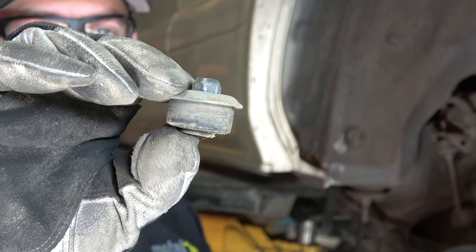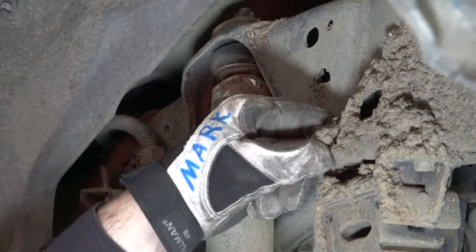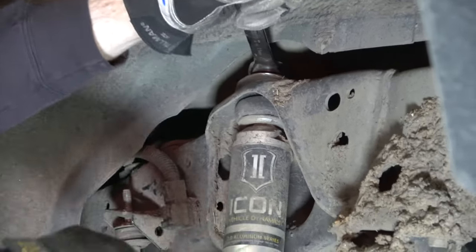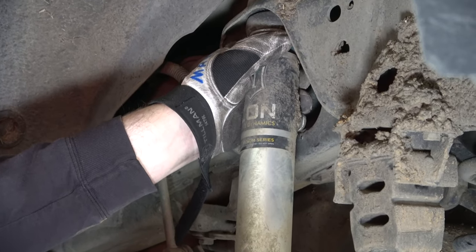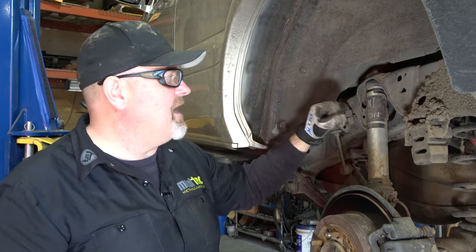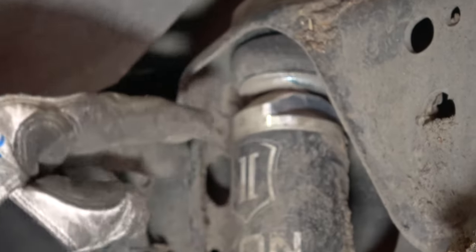That's the sequence when you put them back on again. Now we're going to take the top nut off — and it's great to see this truck is being used, actually getting out on the trail. We've got nice chunks of dirt to work with, but I'm happy to see the truck being actually used. So it's rotating on us — this top body is going to move back and forth, so we need to keep it from moving. We're going to take advantage of the wrench flats that Icon put on here. If it's a factory shock, you can come in with a pair of vice grips and grab hold of the top part of the shaft — that part of the shaft will never go past the oil seal so you won't hurt things. But since this is an Icon shock, it has those wrench flats they put in for assembling the top piece, and we're going to take advantage of that to undo this.